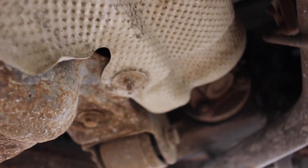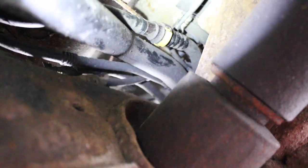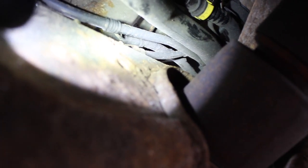We're underneath the vehicle now — very tight on space even though I've jacked up well. First thing we need to do is remove the dust shield that protects the drive shaft going to the back. Then we need to remove three hoses at the rear of the tank. The main filler neck hose is just a jubilee clip. There are two pipes further back: one with a yellow clip and another with a grey clip. The yellow one you can get from underneath and the next one you can reach over the rear tire, right beside the wiring harness for the handbrake module. We've now got our three pipes off, the fill neck pipe removed, and the dust cover off the drive shaft removed.